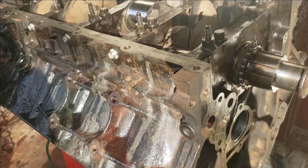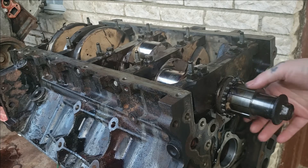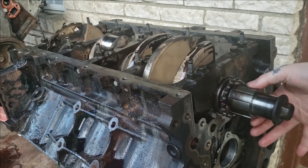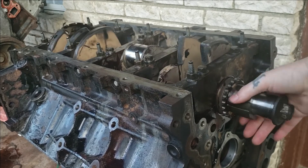That's a little bit over but that works — you get the idea. So that's pretty much got everything torqued down the way it's supposed to be. The mains are doing good now. You can take and spin your crank, and it spins over really good — I could actually spin it with two little fingers, hardly any force.